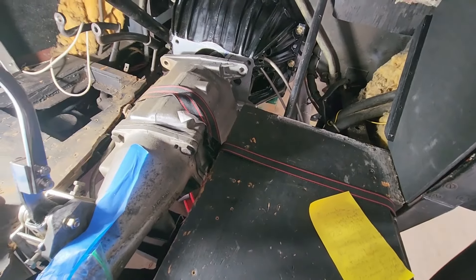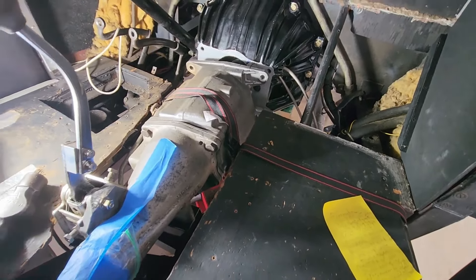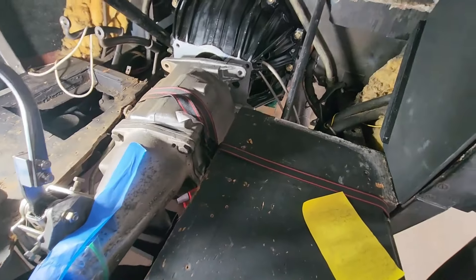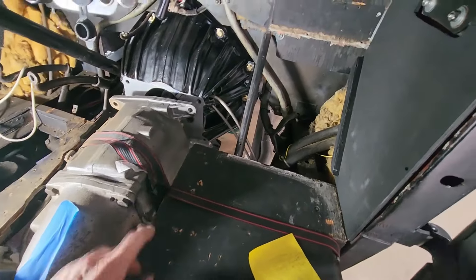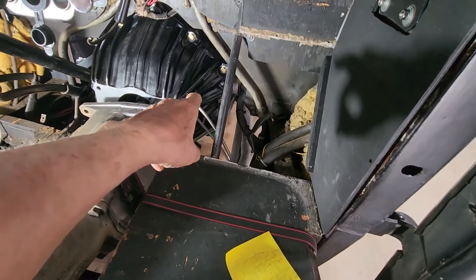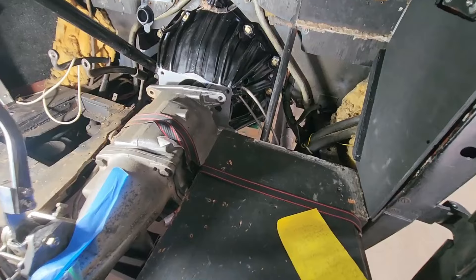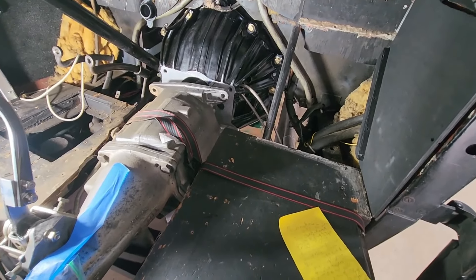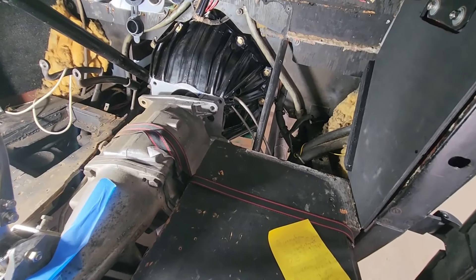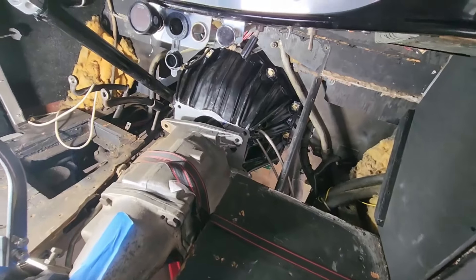I think I'm going to ask Lou if he can come over and help me manhandle this so we can get it all the way in. I also triple-checked the flex line hydraulic fittings to the wheels — I wanted to make sure that the risers that are direct were tight and the AN4 connections were tight.